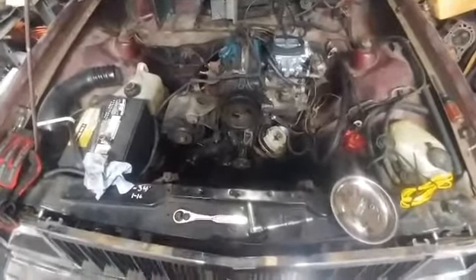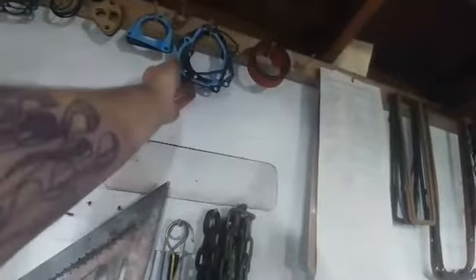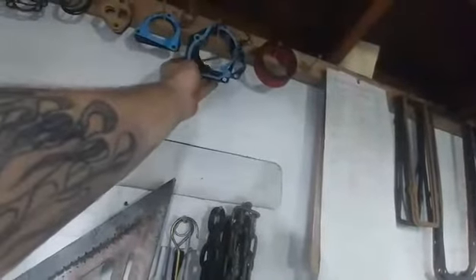So there's that, and the oil leak is coming from the tin cover in front of the engine. I have a whole stack of these seals right here for that. Do I have one for the tin cover? I don't think I have one for the front tin — those are all water pump. Yeah, I don't have one for the front tin cover, but not really a big deal because I can just make one.